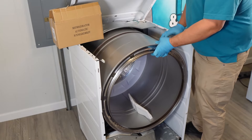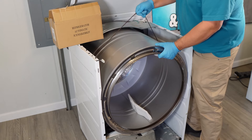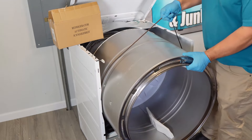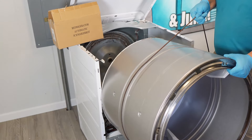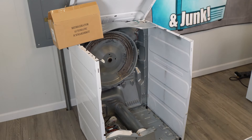Use the belt when it's free of the pulley motor to pull up and then out on the drum. The metal sides of the dryer have little grooves that will show you the shape of the drum so you can pull it out directly. If you pull up too far or too low, it'll rub on the sides or make a noise when it comes out.